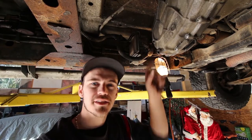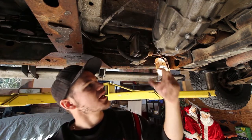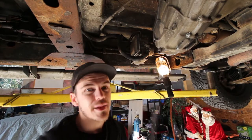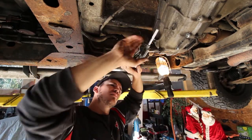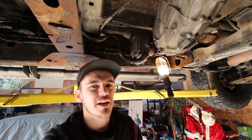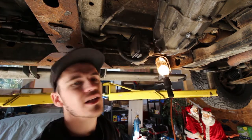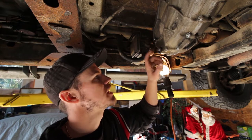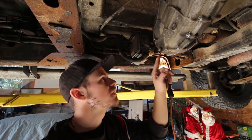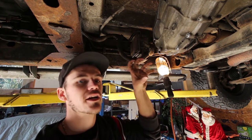I got a new tap for it. There's some oil still in here which is kind of good - it'll work as cutting oil. I need to find a handle for it. Looks like there was a little bit in the way but not much. On these transfer cases there's a tapered plug up top and a tapered plug on the bottom. I don't like the idea of having a tapered plug on the bottom.